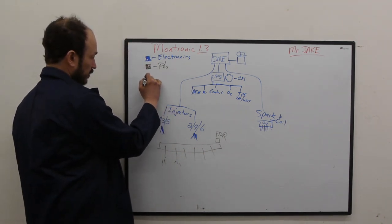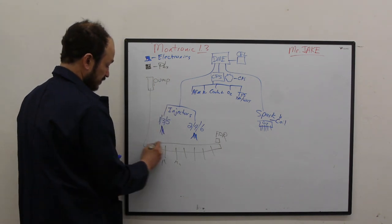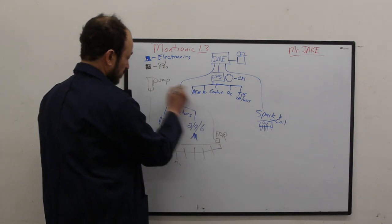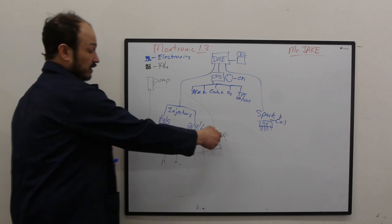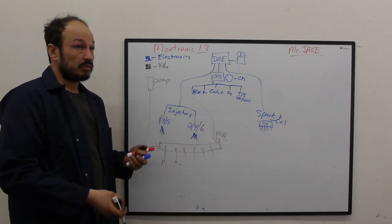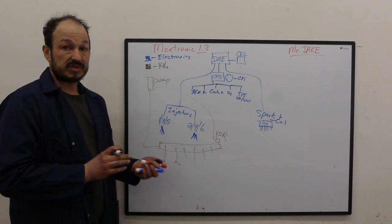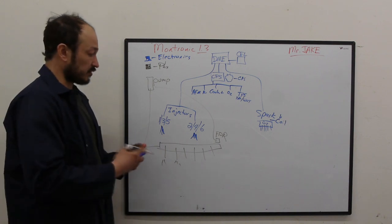We're gonna put our pump right here. Okay, we have fuel lines that come this way. They come then out of the fuel pressure regulator and back to the tank that way. Okay, so the fuel pressure regulator is what controls the fuel pressure. It actually lives at the end of the system, and it's just like a stopper creating pressure on the other side of it.